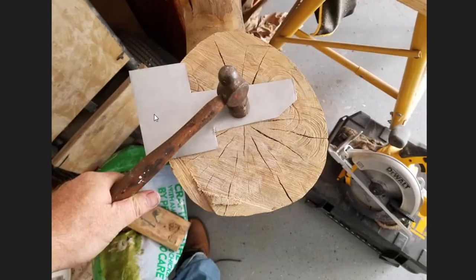Here's an example of what I use to bend the metal. I have a log — you can just use any piece of wood. The end grain doesn't dent; it stays nice and flat even after you hit it and rebounds well. When you're bending the metal on a piece of wood as opposed to an anvil or harder surface, the metal doesn't squish or flatten out and deform — it'll just bend really nicely. So use a piece of wood rather than a hard surface or an anvil to shape your metal.